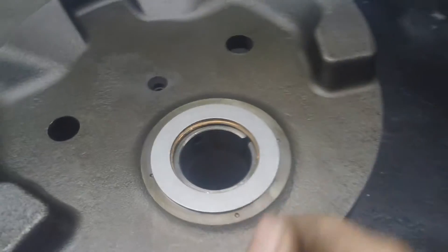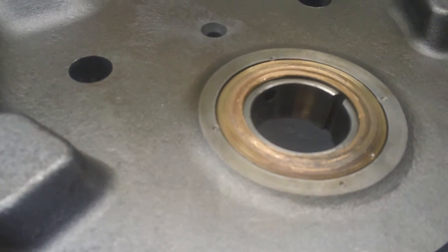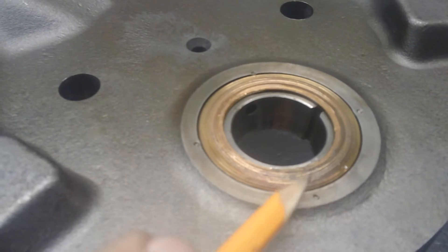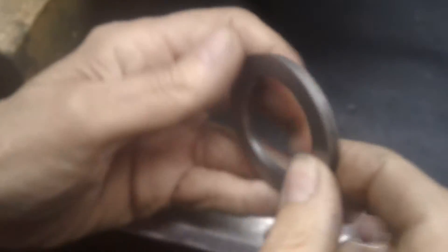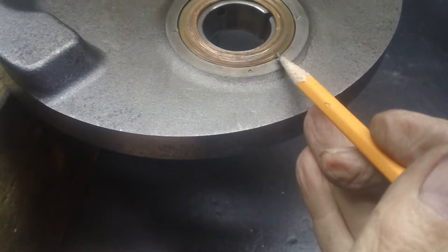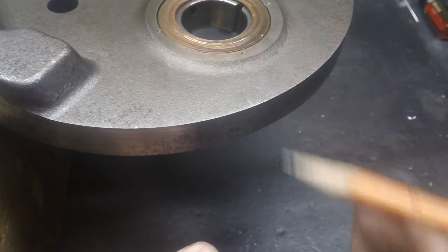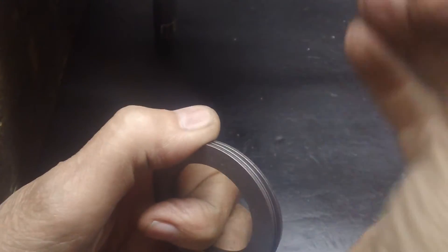If you'll look at this: you cut out a path deeper, you drop in a washer, you put in a bearing, you put in another washer — all of these together. You've already measured this. You've measured the thickness of a stock washer. You've done the math, subtracted one from the other. You've cut this down a little deeper.